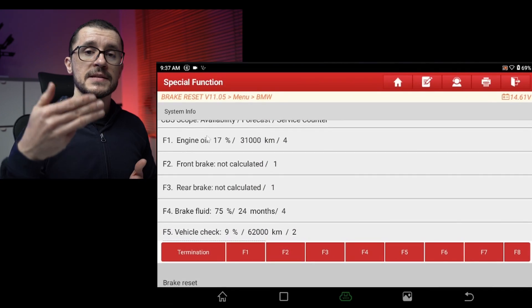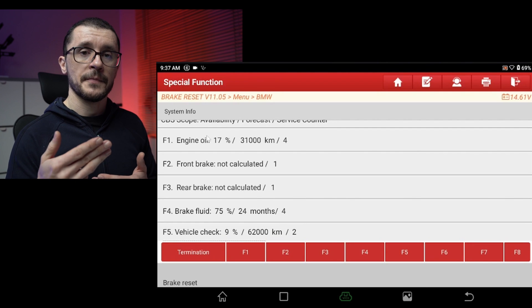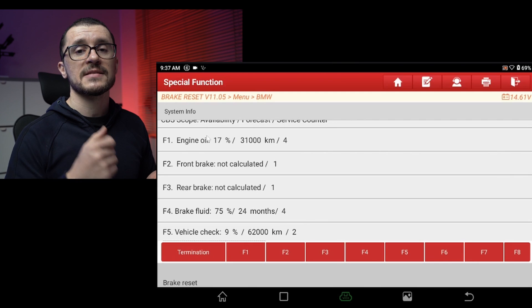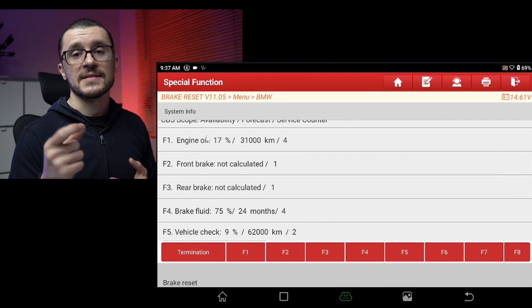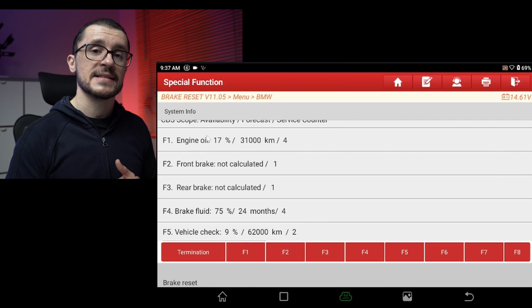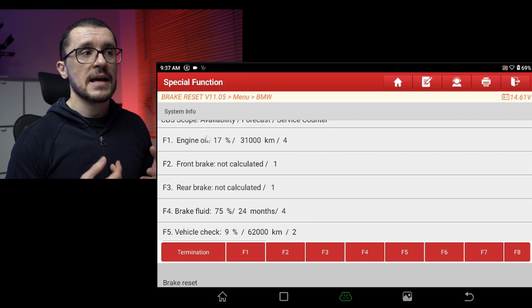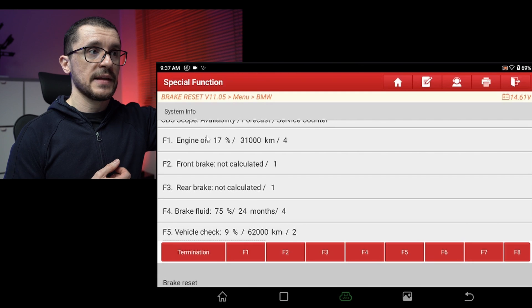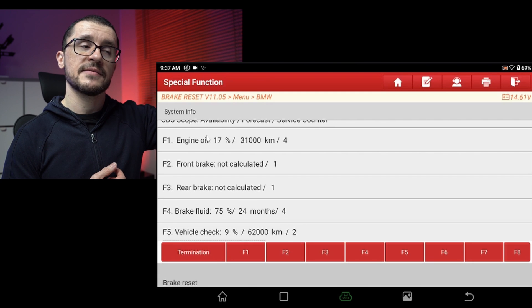Recently I've noticed that BMW, specifically on the brake part, doesn't give you availability of that resource until your sensor is completely filed down. It will not give you a warning until the last 5000 miles, when the sensor starts to give information that something is happening on the system. As a side note, when you are looking at these values, you're able to tell how much availability of that resource is still in the system.